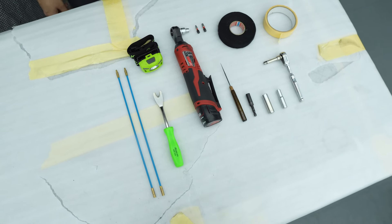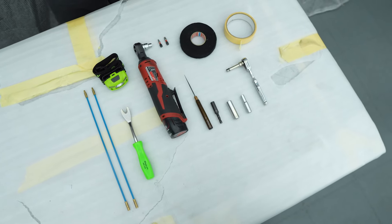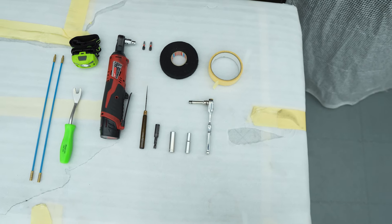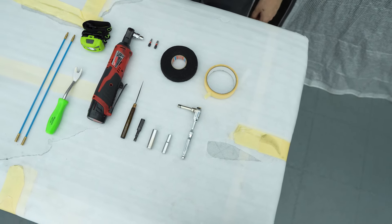To fit our Hunter's Ambient Light Extension Kit you will need wire guides, a head torch, trim tool, a pick, a T20 and T30 torque bit, electric ratchet, a 10 millimeter socket, 7 millimeter socket, felt tape, masking tape, and a ratchet.